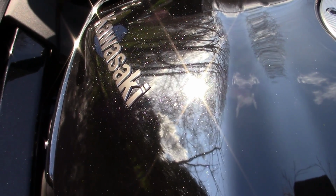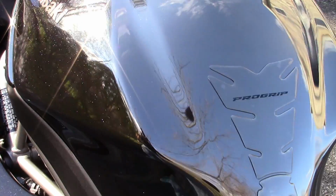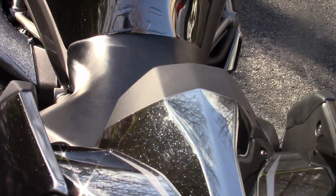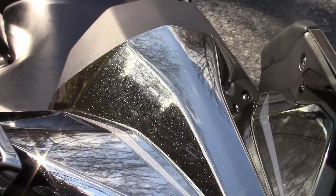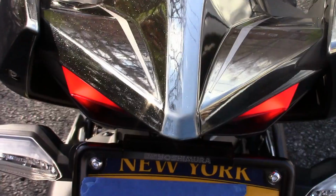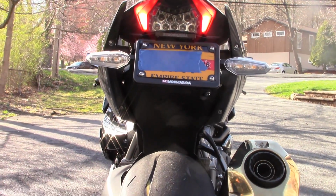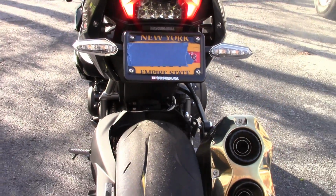Now, to work around that, you can play with the height of the tire. Maybe throw on a slick, a 195/65 racing slick, or a DOT race tire that probably runs a 190/60 profile if you need something taller. But it would be nice to fine tune the settings when you're not running the race tires. Maybe you're running a regular street tire or whatever. Or maybe you throw on the slick, but you don't want so much ride height with the taller profile tire and you want to drop it back down. So that would have been nice as well.